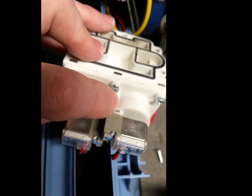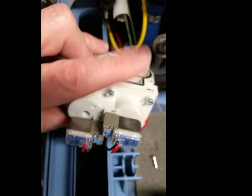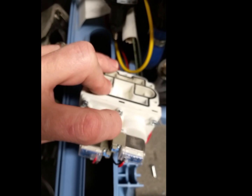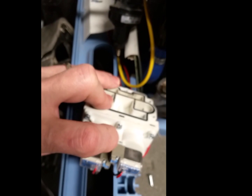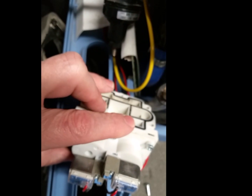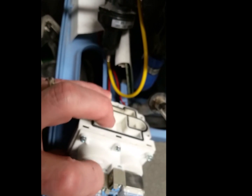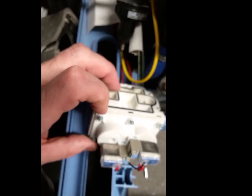It's a number one nut and you can't find them anywhere — I had to buy them from Respironics, so they're really hard to find, so don't lose the nut. Now the problem is, if this is a black housing, the length of the screw will be different, and if the bolt is different you won't be able to attach these valves to that housing. Generally this is the problem — it's the housing, not the solenoid. Generally the solenoids are fine. It's in the housing, so I'm going to change the housing right now.